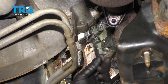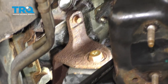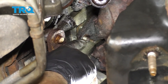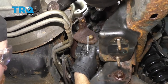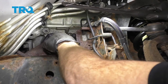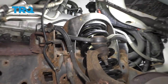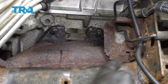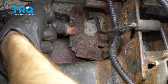While I was taking off one of the nuts, the stud ended up coming out, which is actually great — because essentially, once you have all of your nuts out, you have to continue by removing all of the studs. That's gonna make it so you'll be able to get the manifold off of the actual engine. Now that we have all the studs out of the lower area, let's start making it so we can work on the top. To get to the upper studs, two of them are pretty apparent, but as far as the other two towards the front, they're much less apparent.